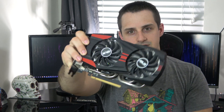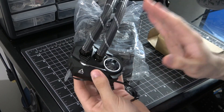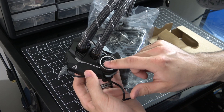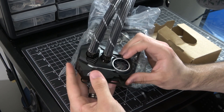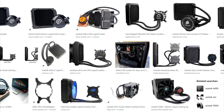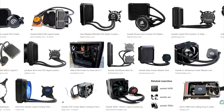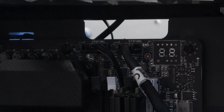The block itself has this angular design — it kind of reminds me of this graphics card right here — more of a race car kind of angular design, along with that little transformer-eye looking fan. It's a 40 millimeter fan and it is also completely silent. Some people will say that fan doesn't do anything, but most AIO coolers have no cooling over the CPU area, which the VRMs usually depend on to stay cool, so this will actually help you maintain a more stable overclock.